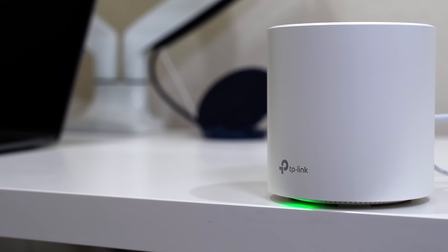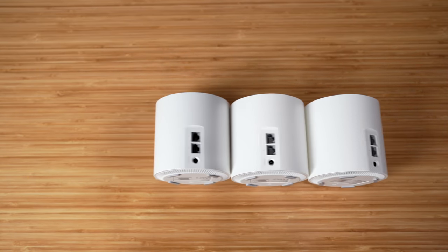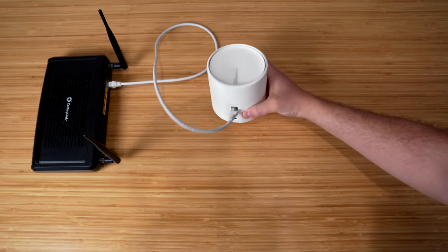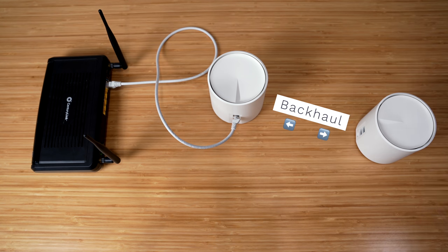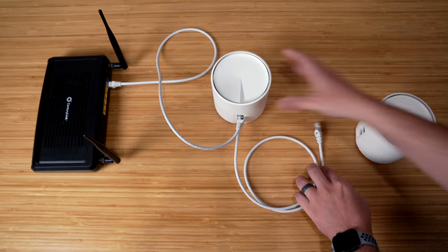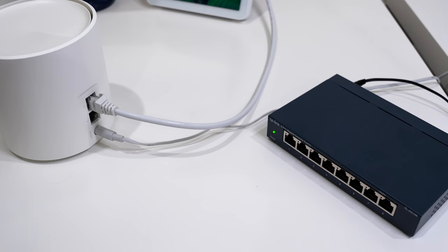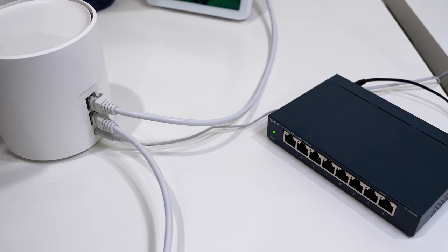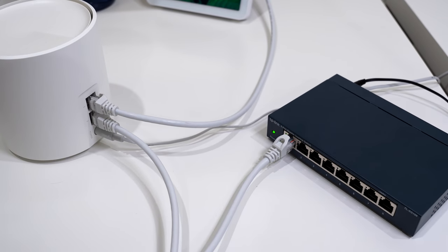Back to mesh Wi-Fi — there's only one really important thing to know about, and that's the backhaul. Each of these Decos are the exact same, but once you plug in the first one into your modem, it will become your main router. Then when you turn on another Deco, it connects to the main one with what's called backhaul. There's wireless backhaul and wired backhaul. You can plug your Deco into ethernet to connect to the main Deco router for wired backhaul. There's only two ethernet ports on these, but you can use an unmanaged switch to expand. These are inexpensive and you can plug them in the back of your main or satellite Decos to extend the ports — you don't have to do anything else to get it working. But if you don't have ethernet throughout your house, then you'll have to use wireless backhaul.